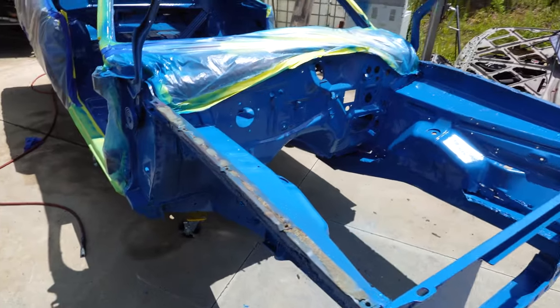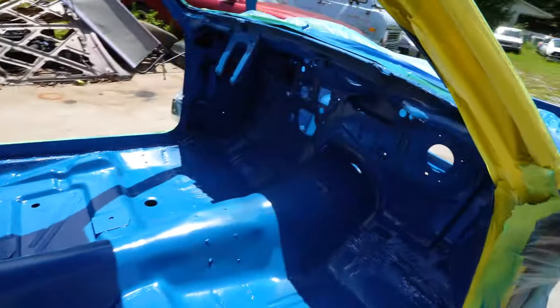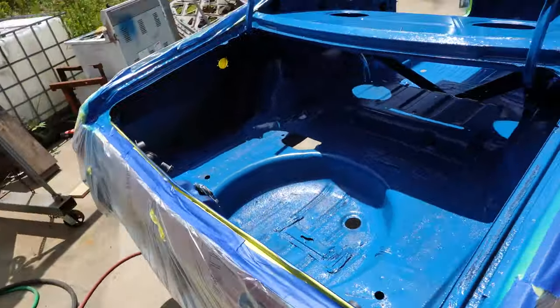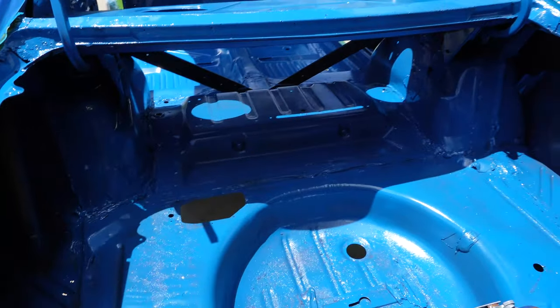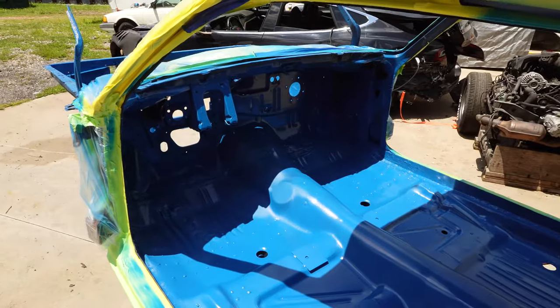At any rate, it is now blue. We've got all of our wheel wells, the front end, the interior, the firewall, the ceiling — which actually was never painted — touched up the deck lid, and we've got the trunk painted good enough. Made a mess, I'm covered in blue. They call for 24 hours between coats, but in my experience with an application like this, one coat's more than enough. I still have the bottom of the car to do, but we're going to brush that on on the lift so I can get really good coverage. For now, we're going to let this beauty bake.